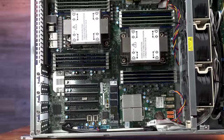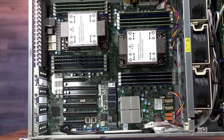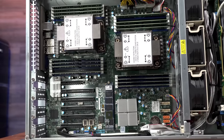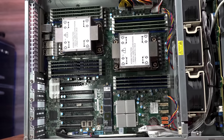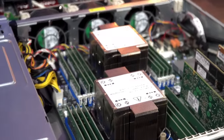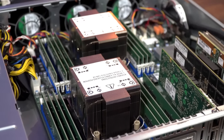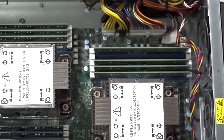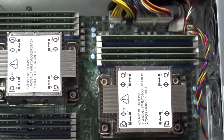Taking a tour of the server, you'll find Supermicro's X12 DPI NT6 motherboard and a pair of 4189 sockets, both filled with Intel Xeon Gold 6330 CPUs — 28 cores per CPU, for a total of 56 cores and 112 threads. The CPUs are flanked by a rather odd layout of 18 DIMM slots. With each CPU wired up with eight channels of memory for a total of 16, the two extra slots are reserved for Intel Optane Persistent Memory DIMMs.